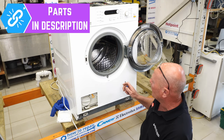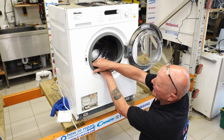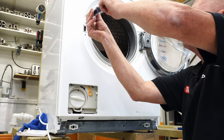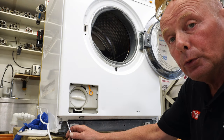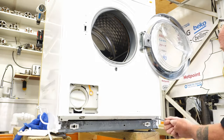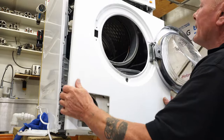That's a good component and we'll put that on the site. You'll notice there is a Torx 30 in the middle — this needs to be undone. Then you can just peel the door seal back all the way round and tuck it inside the machine. Next, we need to remove the two screws holding the door lock in place — Torx 20 again. Underneath the machine, depending on the model, you will find two or four screws. Normally the ones with two screws on each side only need one undone. Once you've removed the two screws, lift it forward and slide it down, and the panel will come away.